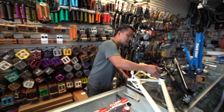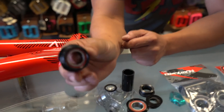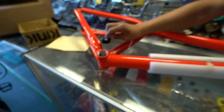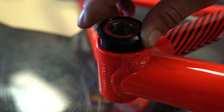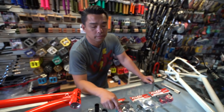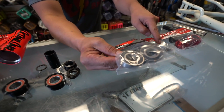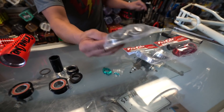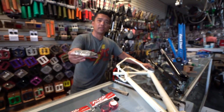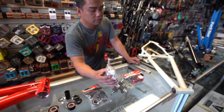So we've now covered American, Mid, and European. This right here is a European bottom bracket — notice the threads. It screws into the frame. The Mid bottom bracket is just a bearing without threads or casing. It goes into a Mid shell and all that requires is grease and a bearing press.